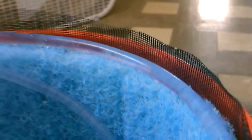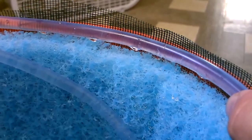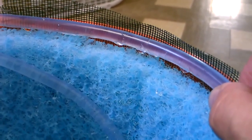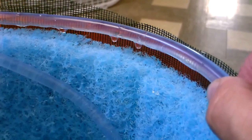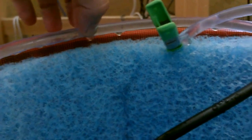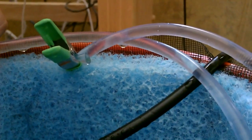A little dry right there — let me add a couple of holes to the hose, that's all you do, and it'll just dribble down into the pad. Start by putting maybe one hole every centimeter, a couple holes every inch, then you can double or triple that if you need to. That's the consistency I want it to drip at. Notice how I have the end clamped off — otherwise most of the water just comes flying out. Any sort of small fountain pump will work in here.